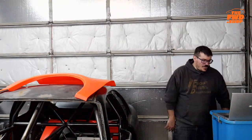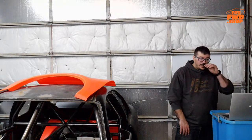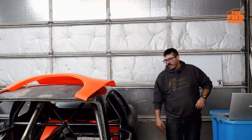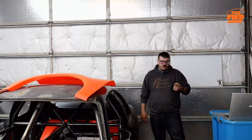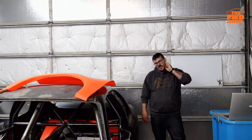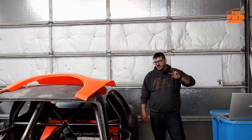Okay. Where can I get them? The get what, Tom? The knuckles? You pull yards, junkyards, any place that you would buy used parts. I don't know. The Shadow Knuckle thing is one of those. I don't know the year. They're like the later model versions or runs of those. So you'll have to look because not all of them had the bolt-on caliper brackets. Not all of them had the bolt-on wheel bearings. And if they have those two things, they're guaranteed to have the ball joint location. But if they don't have those things, they may or may not have it.